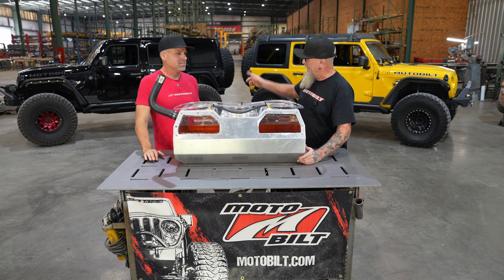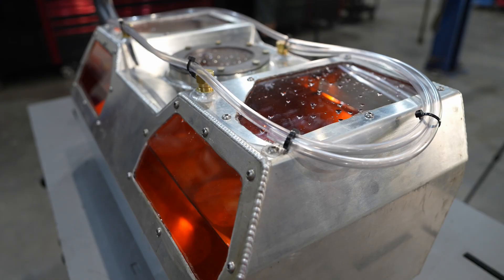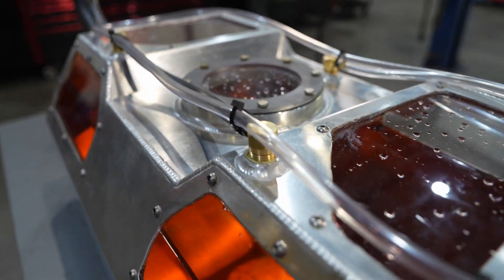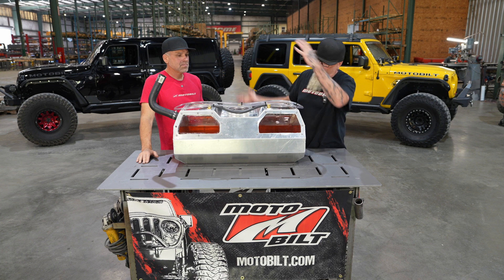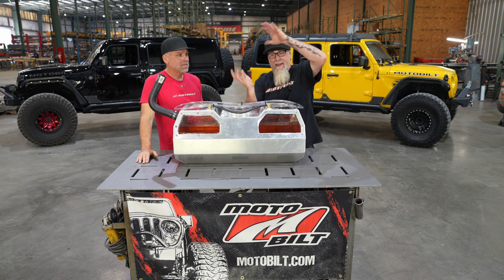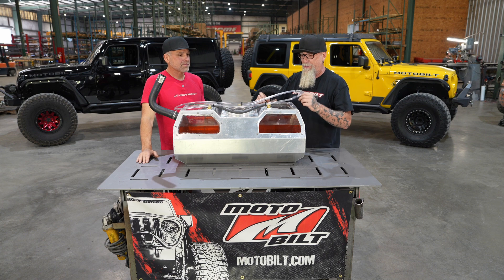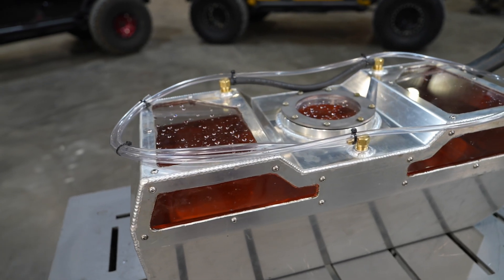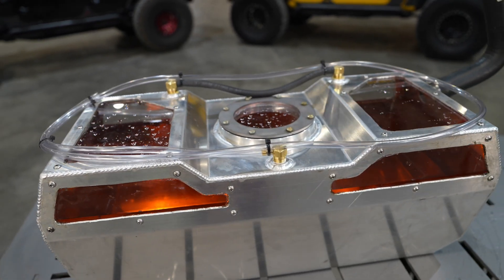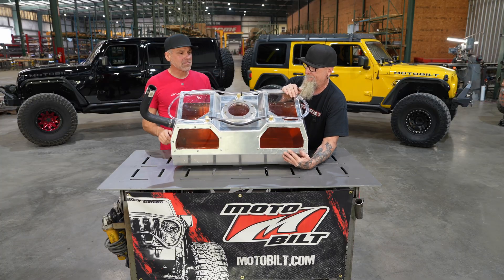This tank is actually a JL tank — hence JL's there. We have a rollover vent in the backside of this tank, so it's actually the worst-case scenario. You'd want to vent it right from the center; some fuel pumps have it there. So what we're going to show you is we're going to tilt this thing around in every direction, almost 90 degrees, just to show you that there's no fluid in the line. The purpose is that with the tube extending out past the tank, no matter which direction, the tube is the highest part.